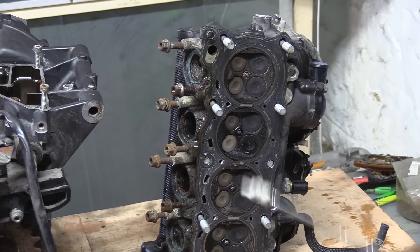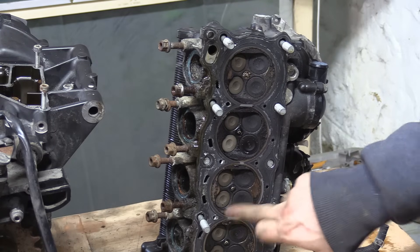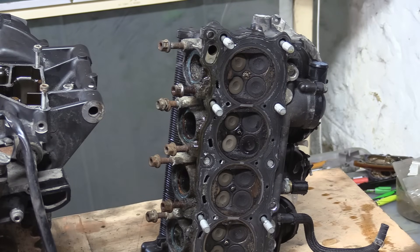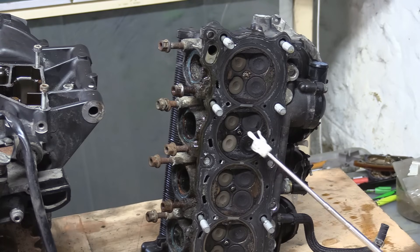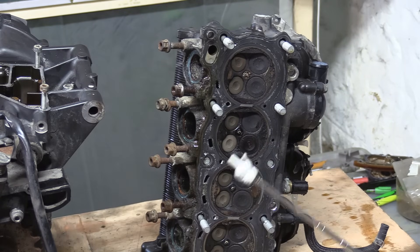There's nothing wrong — it just needs cleaning up. It's all just carbon; this is normal. This is what an engine looks like after 8,000 miles. You can always tell which are the intakes and which are the exhausts because the intakes are always cooler, meaning carbon can condense and stick on them more. On the exhaust side the carbon just gets burnt off — not literally on fire, but the energy prevents it from adhering.